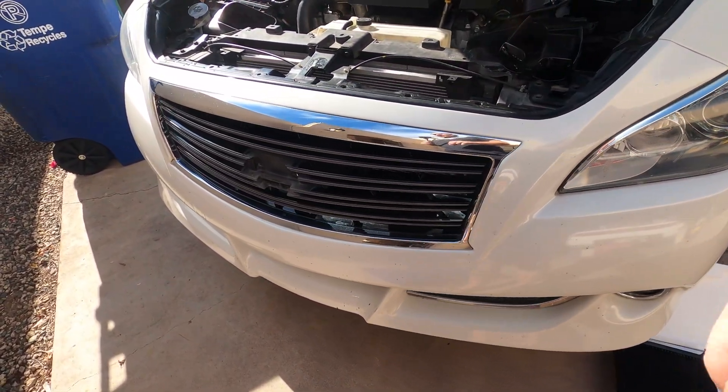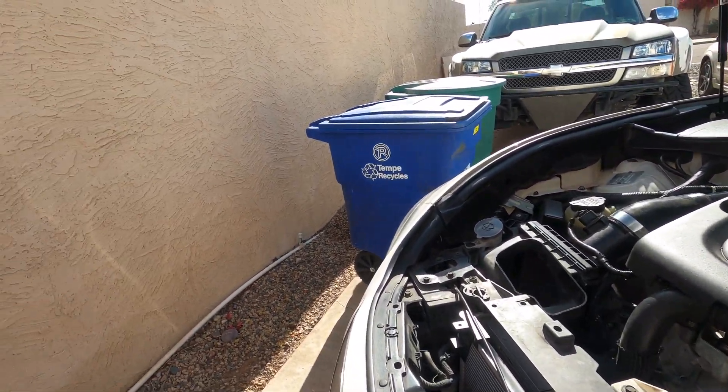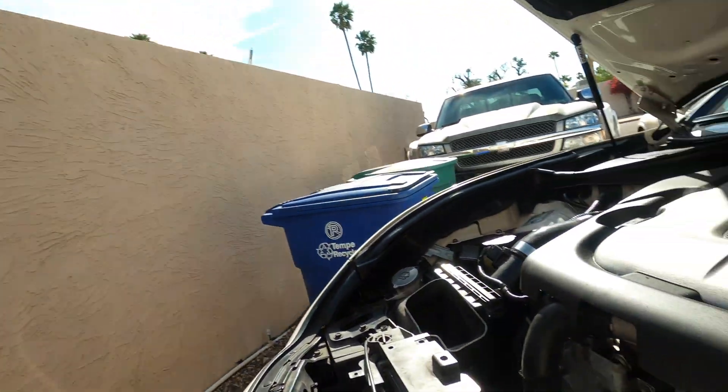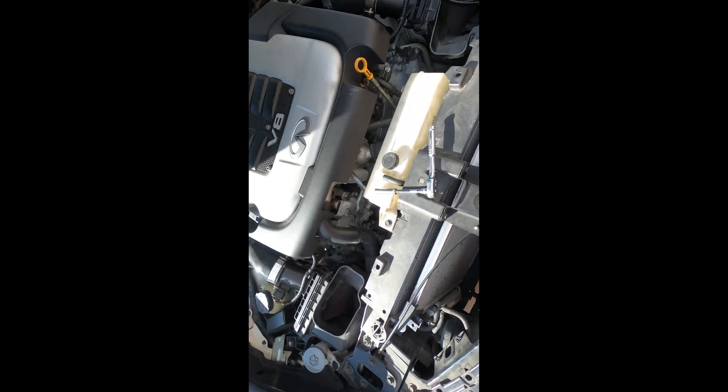After taking a first look, I'm going to take the grill off just to make it a little easier to reach in there. On the back side you can see there are some 10-millimeter screws right here that we need to remove. Going around, there are clips, probably another screw, more clips, and another screw down there — and I think the grill will come right out. As it turns out there are a couple more bolts: a Phillips head right there, and a couple more clips along the bottom row.